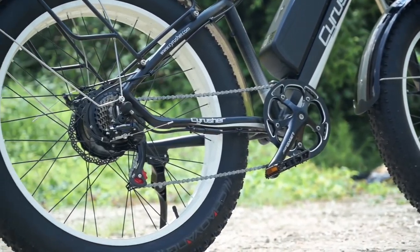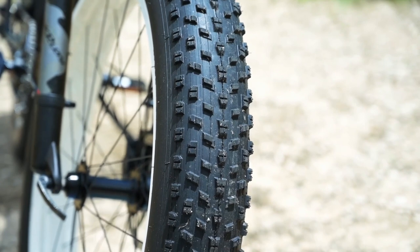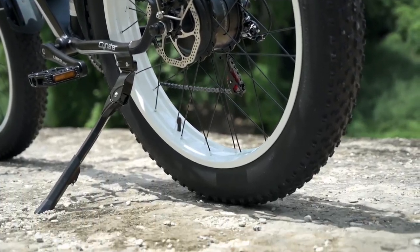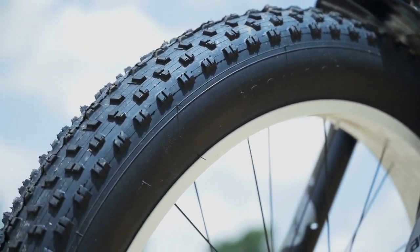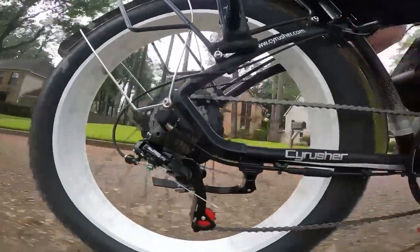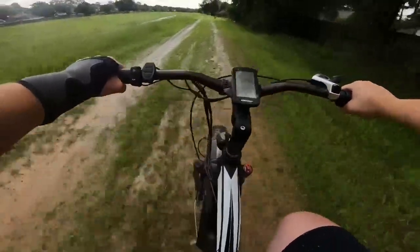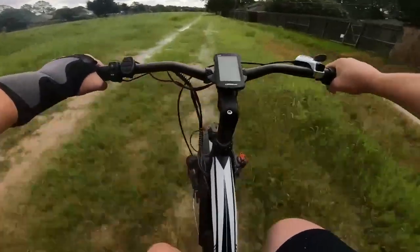The other part of suspension we like to talk about is the tires. We've got giant 26x4 Chaoyang tires with a max air pressure of 20 psi — you could probably take them down to 5, 6, or 7 psi, something you'd have to experiment with. They use regular Schrader valves. As far as grip, they're designed for moderate off-terrain. I had really good grip on pavement and hard-packed surfaces, but once I got into water and mud, the tires were a little lacking — which makes sense, as this isn't necessarily designed for that.